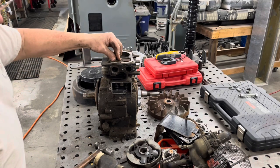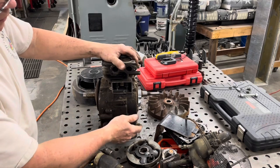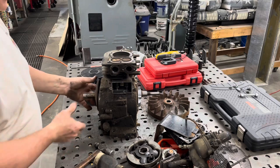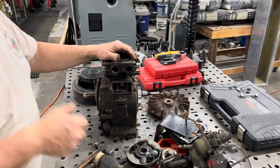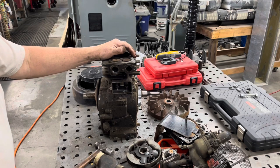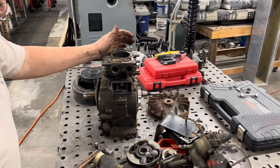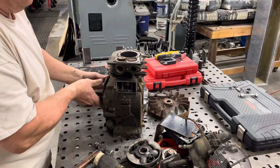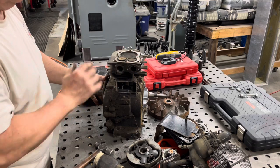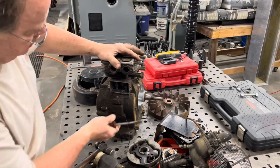What we've got in here — well, typical Briggs and Stratton arrangement. There's a clip on the springs that you have to manipulate the right way and it'll pop loose and the valves will come right out. What I've had to do on another engine — I've got an eight horse Briggs on a mini bike — I actually shortened the ends of the valves, which caused the valve to close sooner than it would normally. So when you go to start it you have to be careful about where you give it the first initial pull.